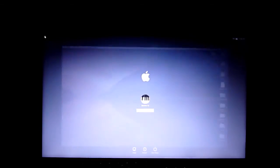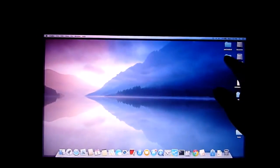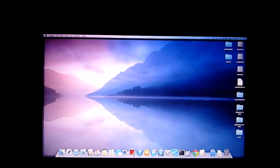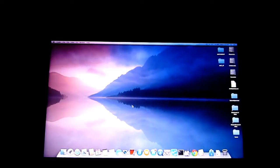This is Mavericks, and I had to patch it — it has one DSDT plus five SSDTs. It has a dual Intel Wi-Fi which doesn't work, so I have to use an external adapter and I'm ordering some. The important thing is that I had to patch this to get the battery and sleep working.